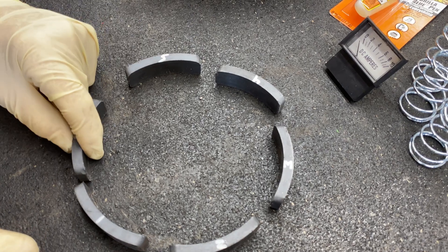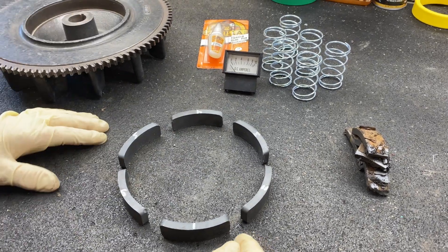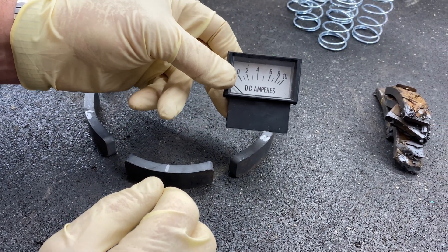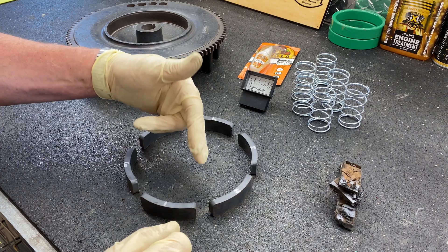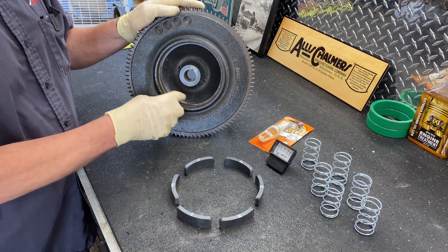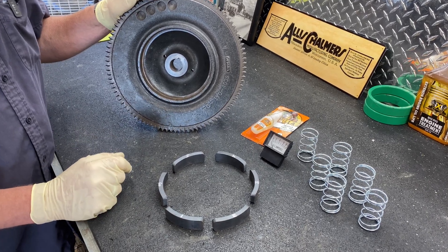They have to oppose one another so that when it's turning, the stator assembly is permanent. You've got a north and south pole magnet passing by the stator assembly in the engine as this is turning. This is the AC side of the charging system. When you get that in there and the permanent stator is fixed on the engine, that produces AC power which connects to a regulator rectifier, and that's what changes it to DC and controls the voltage to charge the battery in these smaller engines.